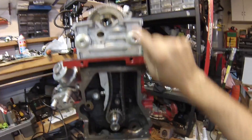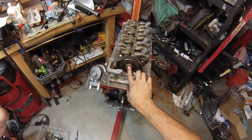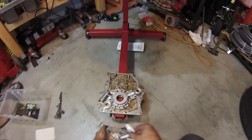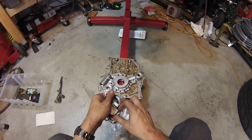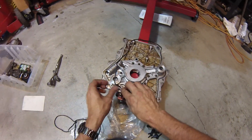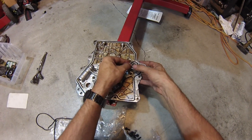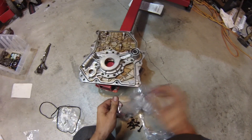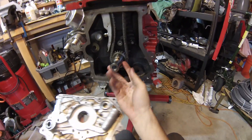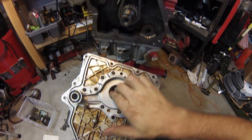We're still lined up with the top mark and with the two bottom marks, so the engine's in time. I'm not going to tighten down this camshaft sprocket just yet — I need something to stop the engine from rotating. Now it's time to work on the timing cover. I already put together the oil pump. Do not forget to put these two gaskets, these little round ones — if you don't put these, you will have no oil pressure. There are two flat spots on the crankshaft; you want to line up the two flat spots on the oil pump gear to line them up.